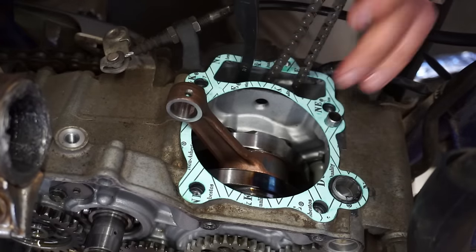We got the gas tank back on. I put a little gas in the gas tank, and the carb was not leaking at all. Accelerator pump was working when we tested it, so that should make for easier starting and better performing machine. So that new kit worked out great. Let's get some oil in it next. This thing takes 1.7 quarts filling up through the frame here.